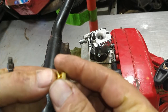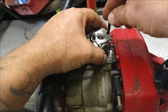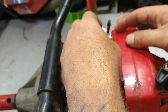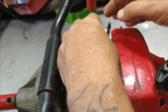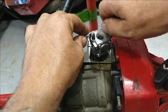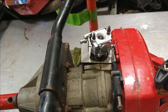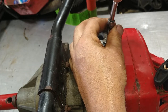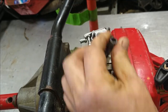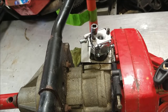I got two new brass nuts from the hardware store — they were 10-24 threads, American thread, 10-24. If you ever need to get them for yours, that's the size. Now we've got to make sure we line the gasket up — lined right up and dropped right in. Get the isolator block lined up with the plate and thread in. Make sure your gasket is lined up. We're going to go ahead and tighten that all down. Get them snugged up first. It doesn't want to go down all the way — might want to use a deep well socket on it. Going around enough for me to get it. Nice and solid.